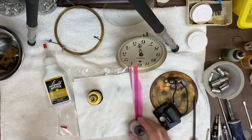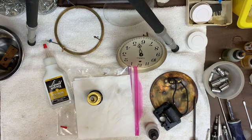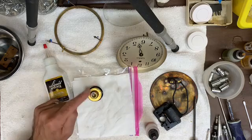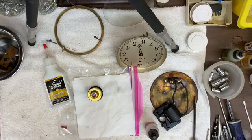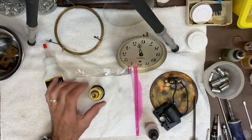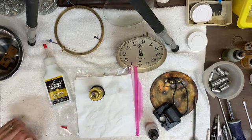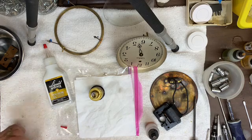And what's interesting is that this is only the second B-type rotor I've worked on. And the first one, it was a Telechron Oxford clock. That rotor was working, and I don't recall if it had a solder plug on it. So I went back and looked at my old video, and I really couldn't see any solder on it. So I'm suspecting that this may have been serviced before. Someone might have drilled a hole to do just sort of what I'm doing now and then sealed it up with the solder. We'll see if I'm successful with this. Apparently it must have worked the first time around.